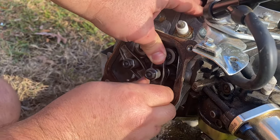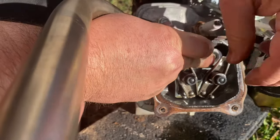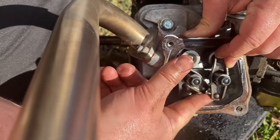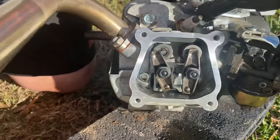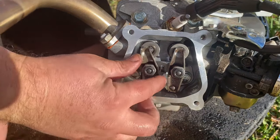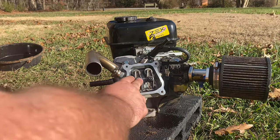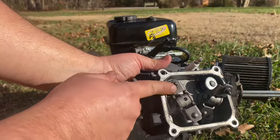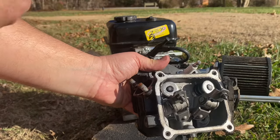All you do is put some pressure on the spring, move this rocker arm back over, slide it back in its place, and make sure that the push rod is back up in its seat. Our push rod is back in its seat and we'll just do the same thing for the other side. Now this is the non-Hemi head. If you have a Hemi Predator, the concept is still the same — the head will just look a little different. You just compress the spring and put the push rod back in its seat.